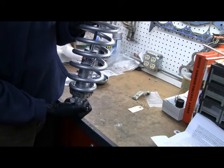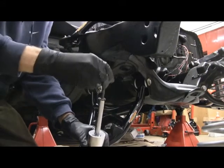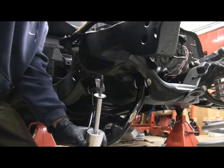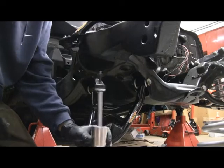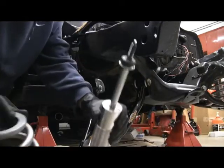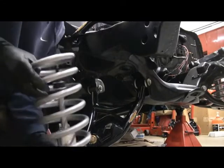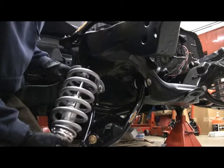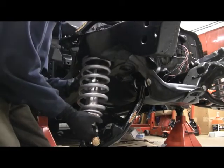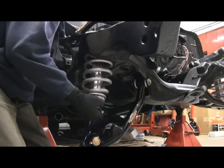Let's go get this thing put on the car. Like any other shock, on the top we need to put some rubber bushings on first. Then put that spring on top of those washers and thrust washer, and all of this goes up into the frame just like you would a normal spring.